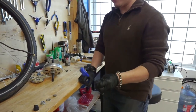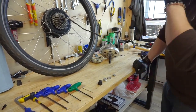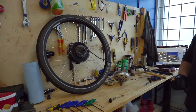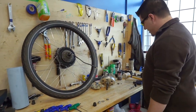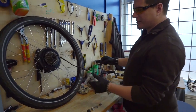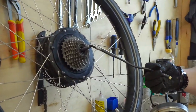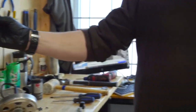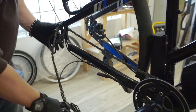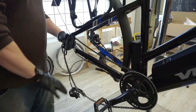If you have a Yukon it might be a 3 millimeter allen key to remove those bolts. For the purposes of this video I have gone ahead and removed the wheel — that's done by spinning off the axle nuts with your 18 millimeter wrench. You're also going to want to snip the cables on the frame in order to remove the power harness.